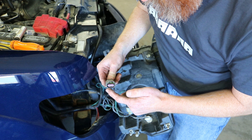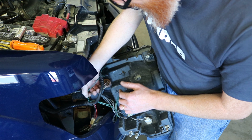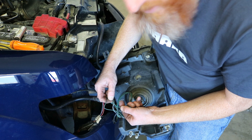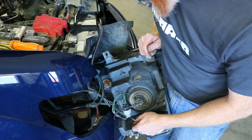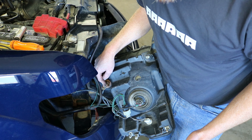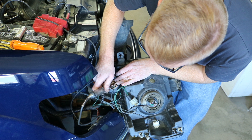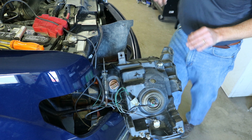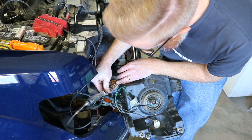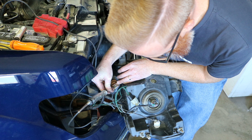It does have a couple of other wires here which we are going to have to tap into — they are your park and turn signals. We'll have to get that done by tapping into them here and here. This is your park light; this is your turn signal. We'll get the test light and figure out which one works what. We know the middle one is giving us our park light, and now we're going to turn the turn signal on and see which one gives us the turn signal. The outside one is our turn signal; the inside one is our park light. So we will connect those together.